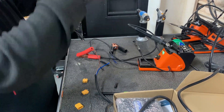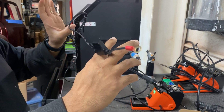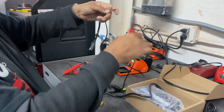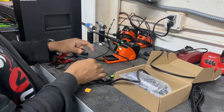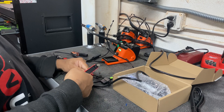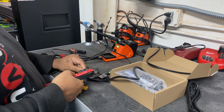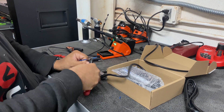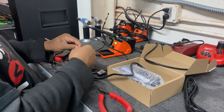Now back on our tender wire, remember the positive leg is actually our negative. So I do it first so I don't forget. I do one side at a time so I don't get confused. If you get confused you're going to blow the fuse on the tender lead on the bike and then wonder why it's not charging. And if you do manage to hook it up without blowing the fuse, the tender is not going to light up — it's not going to let you try to charge the battery while it's backwards.